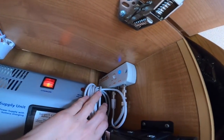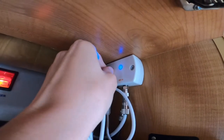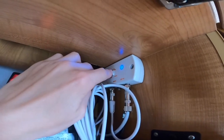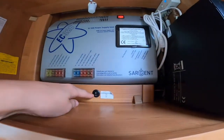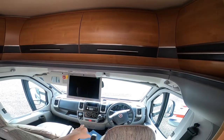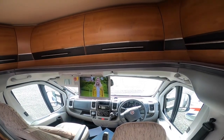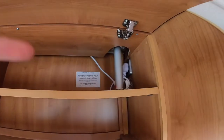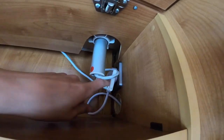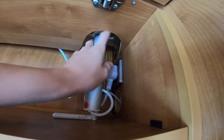As you've got a Vision Plus TV aerial, this is your TV booster — there's a little button on here where you can amplify the signal up or down should you be struggling to get a signal. If it's on max and it's still pixelating, it might be too strong so you may just need to turn it down. Then there's this little switch here which operates the screen, running through the head unit for your TV. Once the screen's on, you'll be able to see the telly. The aerial is in this cupboard — if you're struggling to get a signal, unwind the white nut, push the stem up and use the toggle on the bottom to direct the aerial. But always before travel, pull it in and tighten the nut so the wind doesn't rip the aerial off the roof.